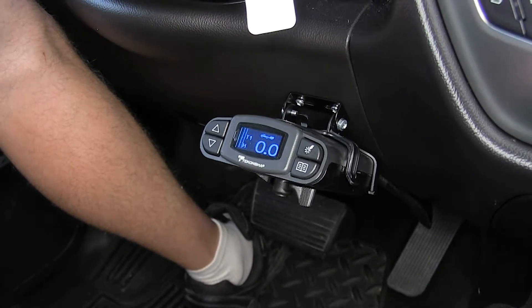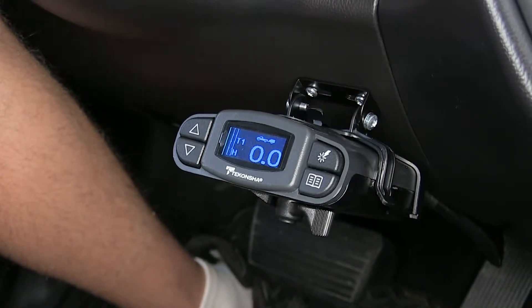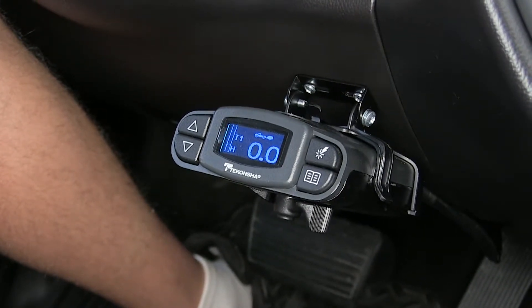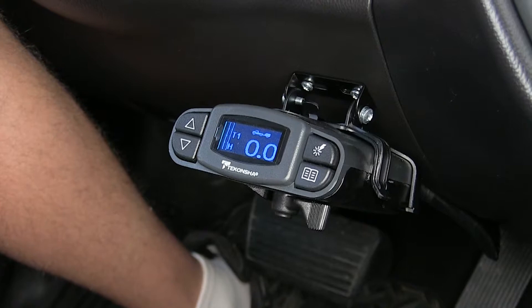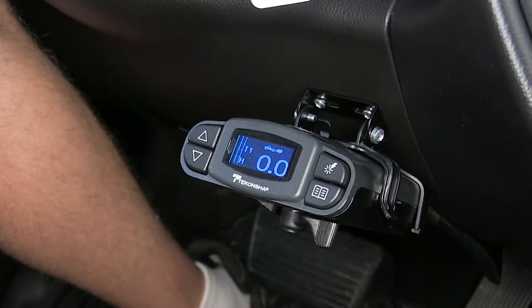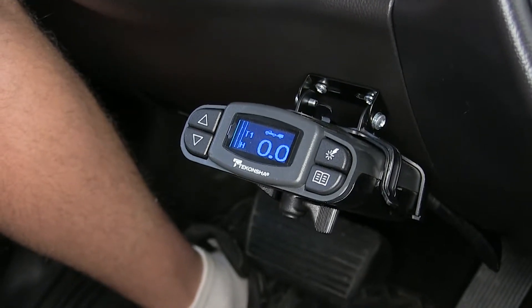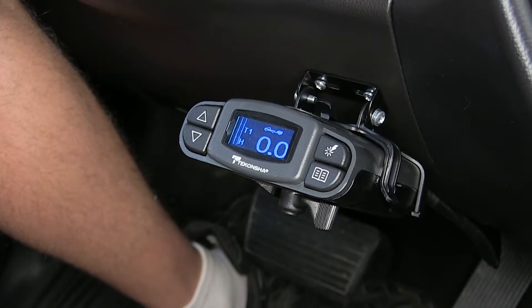You have to be moving in a forward direction with your brakes applied. This brake controller will allow you to tow a trailer up to four axles, controlling four sets of electric trailer brakes. It will also allow you to control electric over hydraulic brakes without any modifications required to the trailer or your brake controller — it automatically detects those once you enter the proper setting.